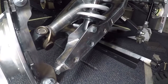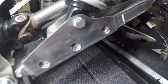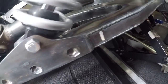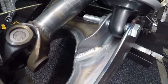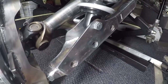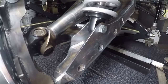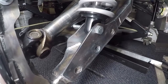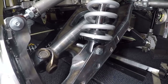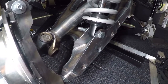So this is my final product here. I'm done welding up the brackets on the lower control arm. I did end up putting three holes in the side plate so that I could do some rosette welds, because I really wanted to get it welded as solid as I could to the side of the control arm. In a separate video I made the inside tab and got that TIG welded on also. I'm really happy with the way this lower mount turned out. When I go from full droop to full compression, I've got about an inch of shock absorber left on full droop and about half an inch left at full compression. That gives me a little extra just in case I make some minor changes with future designs.